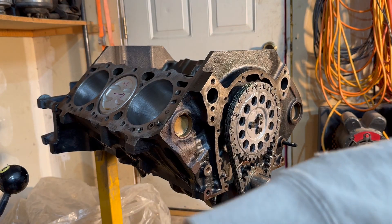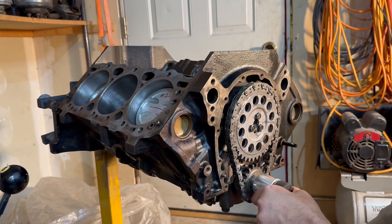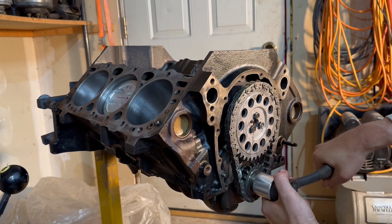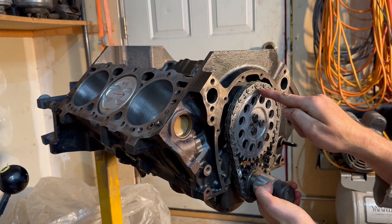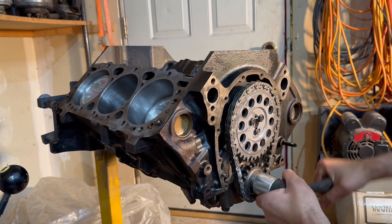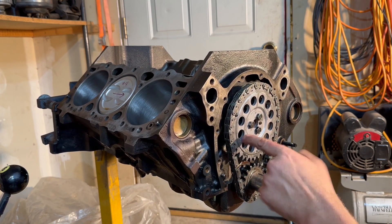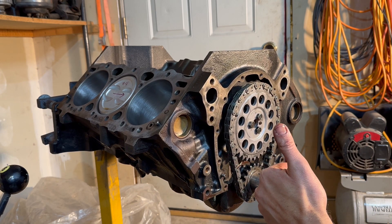All right. And then finally, the last thing I'll do is run it through a cycle or two. I like it — I don't see it binding, I don't hear it binding. Here's the other place you could have done it and it would line up and work right — 12 o'clock and 12 o'clock. But it's so much easier to just go dot to dot. Bring it back around — this time it should line up. There we go. All set. Torqued in. Now ready to apply a timing cover and keep going. Thanks for watching.